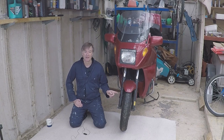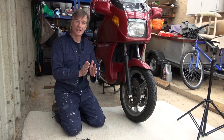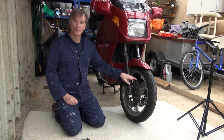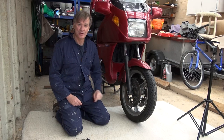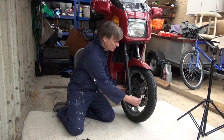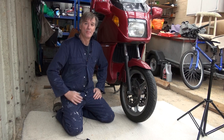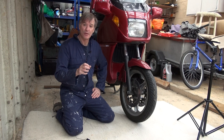The problem I have is that when I serviced the bike I changed the front disc pads and then discovered a fairly big problem with the discs themselves — they need replacing. These discs are designed to float between the two fixed pads. On a motorbike it's the disc that does the floating, and the disc is mounted on these bobbins. There should be absolutely no play on these bobbins, but if you look at my disc it's rattling like crazy. That rattling may not be a safety problem in itself, but it's really annoying and at slow speeds it tends to make the front brake snatch a little bit.